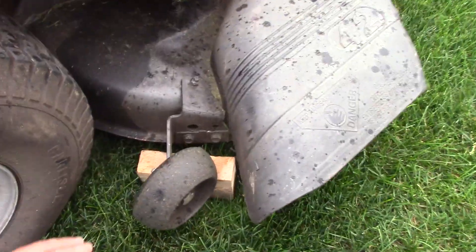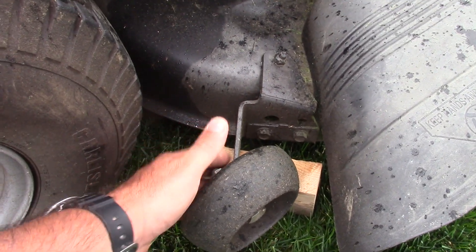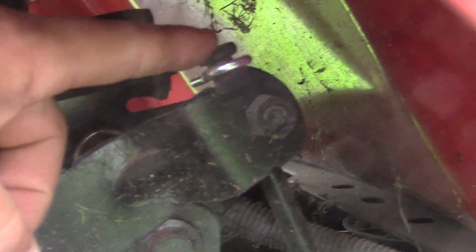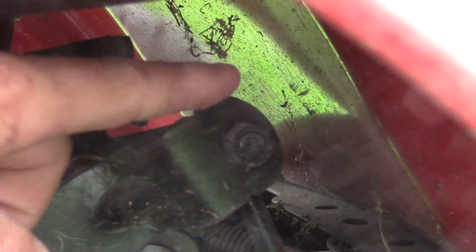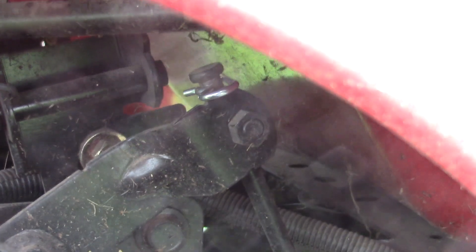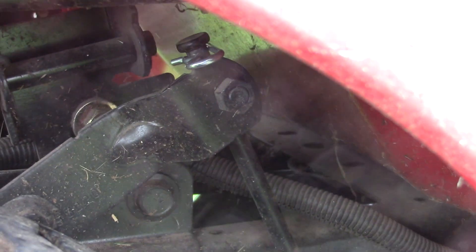Here's the quick fix. You stick a block of wood underneath the deck — or in this case the wheel bracket. Underneath here, you can see I put a hairpin underneath the head of the rod. Sorry, the lighting is not great. You follow that rod up — it holds the deck — and generally the top of this rod is too low. So I put a heavy-duty hairpin on here that won't pop off, and that raises the deck and also allows you to get a level cut with the adjustment on the left.